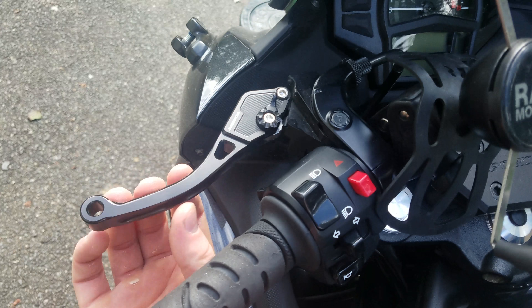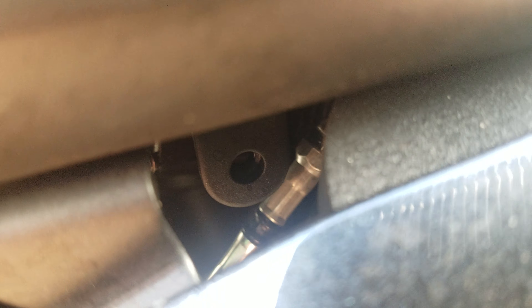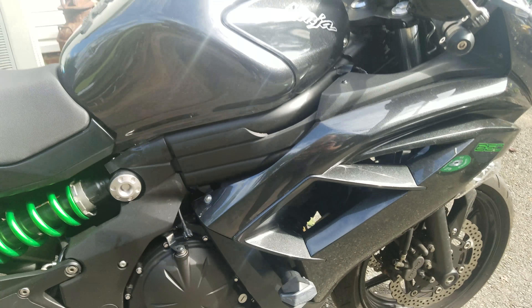That's a sign this is not going to work. This is the other end of the clutch cable. Follow it down from there a little bit further, and behind the fairing you're going to find a little jam nut and barrel adjuster — that's what we're going to use to adjust the clutch cable.